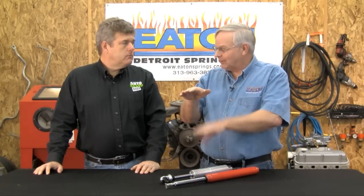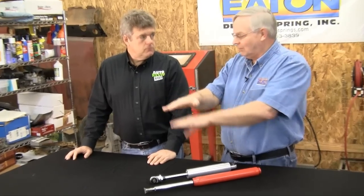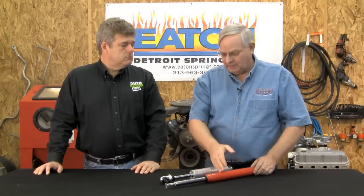The whole car is following the contour instead of just the wheels and axle following the contour while the body stays pretty steady. The whole thing has to react because there's too much strength in the rear or front suspension due to the strength of the gas shock.